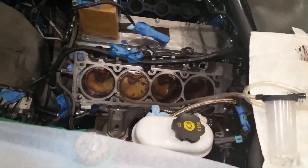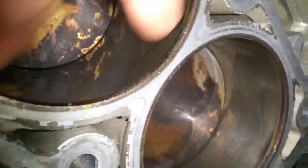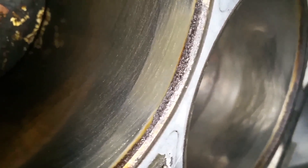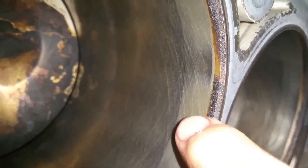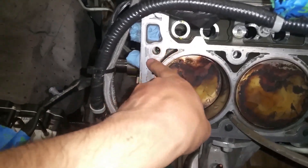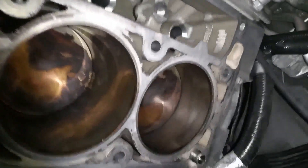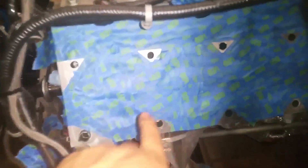Be careful because on the inside right at the top of the cylinder, there's a lot of carbon and that's a pretty hard buildup. You want to clean that too, not just the block surface area and the piston tops — clean that crap off as well.